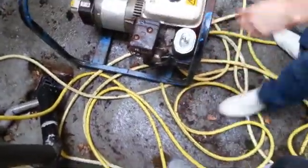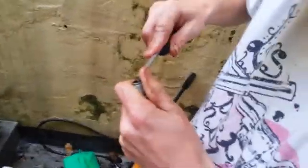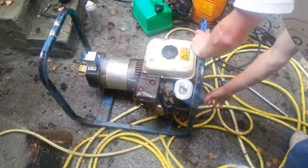So what we're going to do is get our spark plug. Obviously with spark plugs as well you want to test the gap on them. We know it's all right. What you do is get a screwdriver if you need to open it up - get it in there. So you get your spark plug, stick it in there, bring it back in. Just before you do this, put it back in the HT lead, put it up against that metal again, pull it and see if that sparks. You saw previously on the video there was a spark - that's what you need to see, just to make sure it's going to run. So put the HT lead back on, give it a rip. Hopefully it's going to start. Now that would run perfectly now - we know that everything's sorted. Leave it for about 10 minutes running just to make sure it's okay.